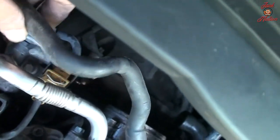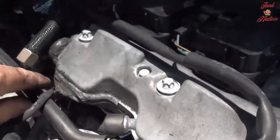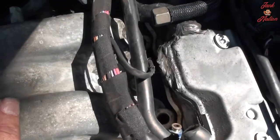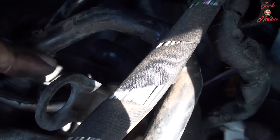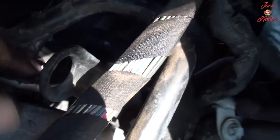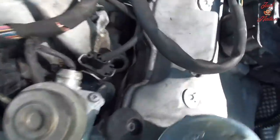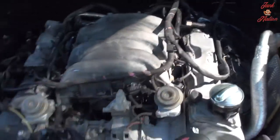Mistaken, the kit for the vacuum hoses is this piece here that plugs into here, and then this T, this smaller piece, and quite possibly this piece here that I broke. Maybe that would be nice. And this is why I'm taking this apart: I kind of jerry-rigged the nipple off of the brake booster, because that's a plastic piece that breaks, and I screwed in a threaded piece and ended up cracking the case slightly. So I've always had a slight vacuum leak because of that. Now I have a solution. I think I have a solution. We're gonna find out.